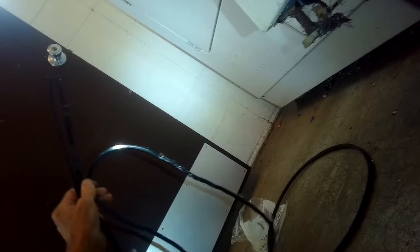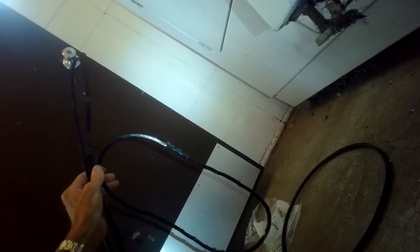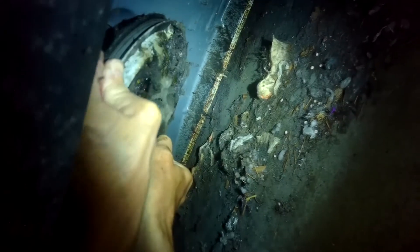We took off the one that goes to the big pulley, which is what makes it agitate and spin, and now we're taking off the skinnier one on the pump. The pump belt looks pretty good, but the one making it agitate and spin is really shiny and cracked. They complained of a burnt smell, so it looks like the big pulley is not spinning properly — the motor is trying to spin it but the pulley isn't moving. That could mean something is caught between the spin basket and the tub, or the main bearing is corroded and worn out. Trying to move that big pulley by hand during the spin portion takes a lot of force.